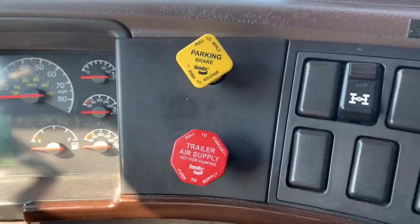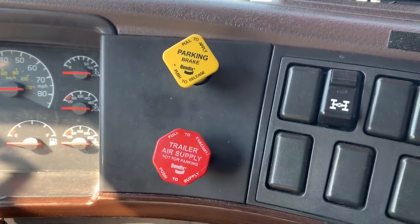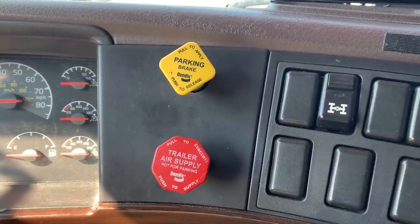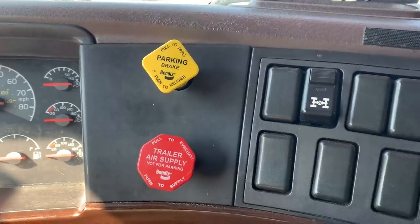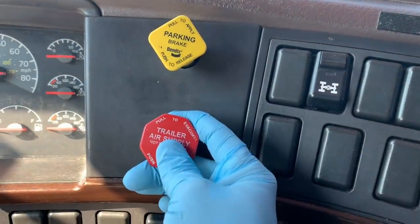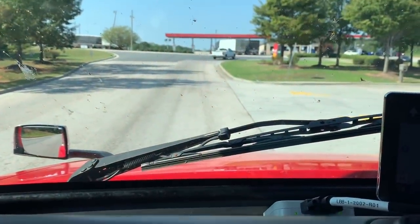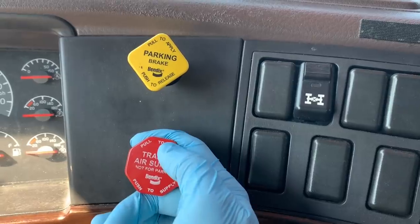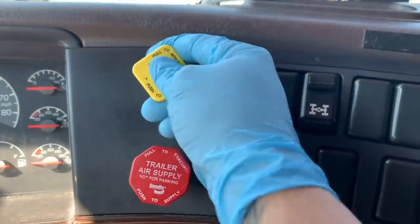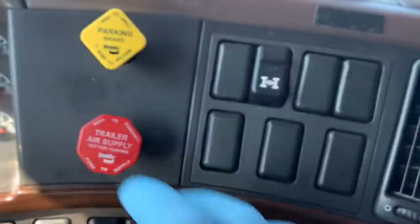Guys, so first, as I was coming down the road, like I said, my truck started to have a lot of problem with horsepower and moving forward, and I kind of figured that it was the brake. Something had locked up on the brake. So what I did was I set the trailer brake, so I knew that the truck, because I'm on a slight incline here, wouldn't roll back because my fifth wheel on this brake was going to stop me. Plus, I chalked the wheels and I let out my truck brake. So I pushed that in, let that out.